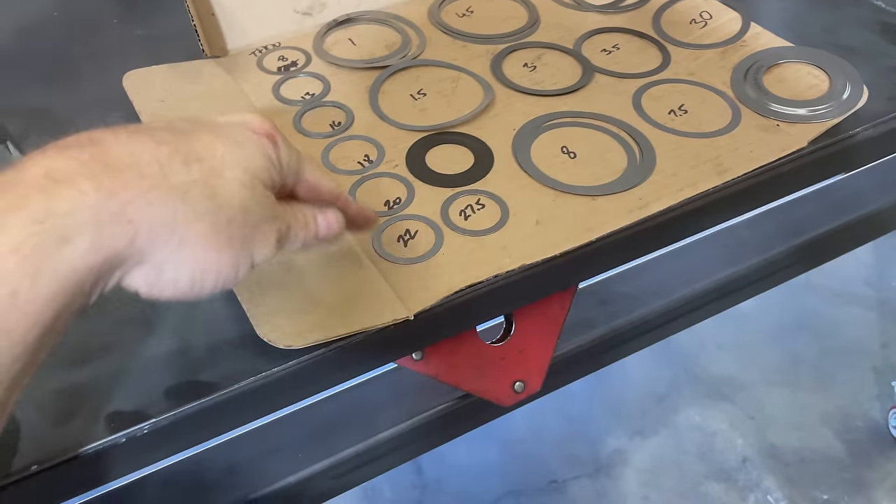That's about seven thousandths by tone. Apparently the case spreader does do something. Our contact patch looked pretty decent, so we just threw some more paint on to get a really good print. When you are checking pattern, you do need to put a little bit of drag into the system.